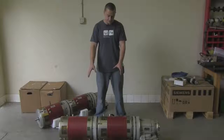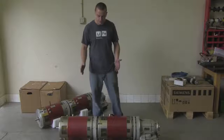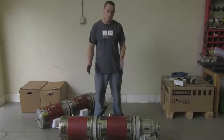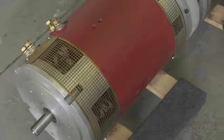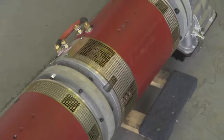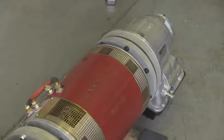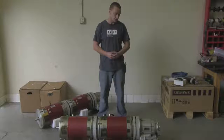We have two 11-inch motors capable of doing 1,000 to 1,200 foot-pounds of torque between the two of them, and you can expect anywhere from 400 to 600 horsepower depending on voltage sag. Overall length of the whole package is 54 inches. On the back we have our two-speed PowerGlide — you can get this in a 1.76 ratio first or a 1.82, and second gear is direct, so just one-to-one straight through.